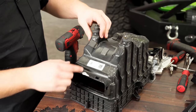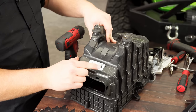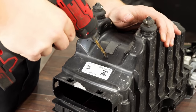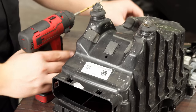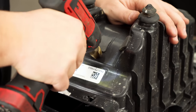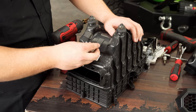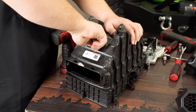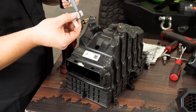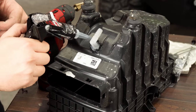After you have all four of those holes plugged, the next step is to actually drill a hole so you can release any water that's underneath here. Since it's going to be completely airtight, they give you a check valve. Flip this underneath and you'll have a sticker here — mark up above from there and drill a hole in this general vicinity. Use a regular bit first, then since this is the piece that goes underneath there, drill it out to the proper size using a step bit and keep working your way up. Using a step bit is a good way to get the proper size. Before we set the angled piece in there, take some silicone and go around the top of the threads — that'll make this as airtight as possible.